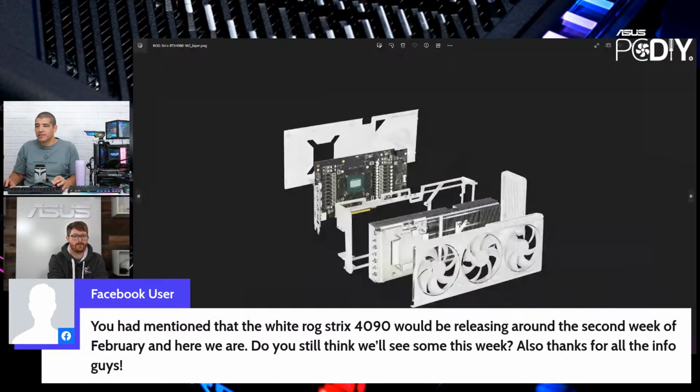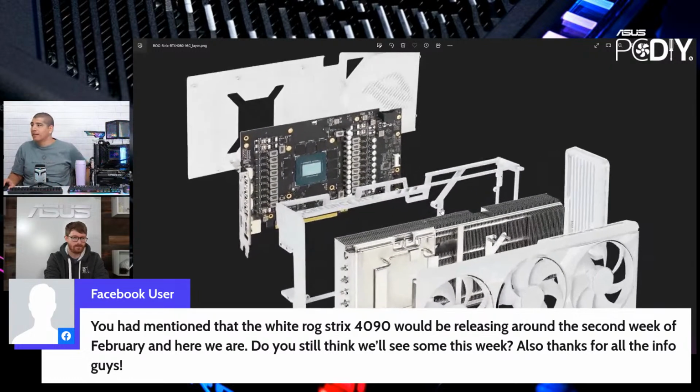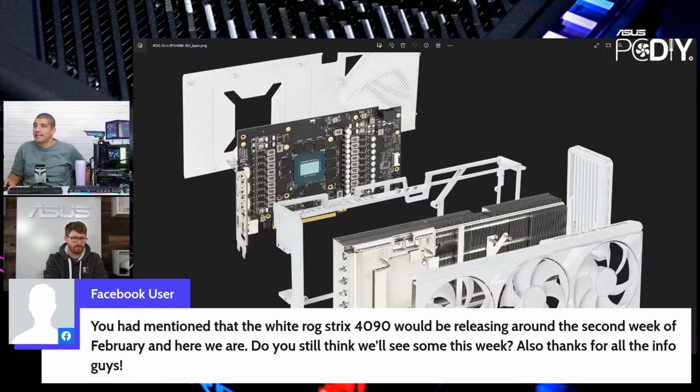And so in case somebody's wondering, this is an example right here. You can see here's the heatsink itself, right? Some manufacturers might have just the heatsink, and the heatsink itself is attached to just the GPU and the card. But that will cause a lot of sag. Here, this entire design, this anti-torsion frame, when it's built in, helps to really mitigate a large amount of sag.